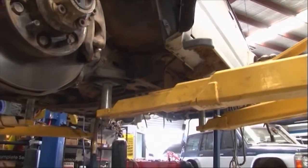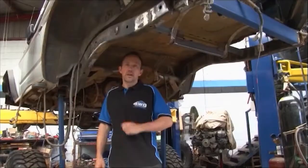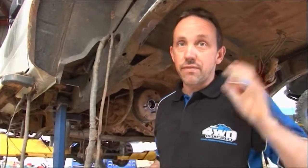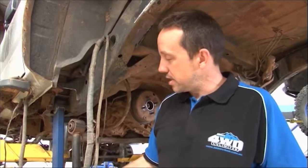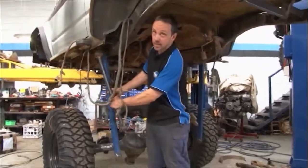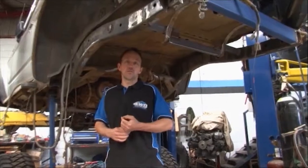Here we have a short wheelbase Patrol. We're doing a mid-wheelbase 4-link suspension conversion. Again, another turbo straight gas car. We've worked out with a fuel tank in the rear, we can get 11 inches longer wheelbase out of this car, and we do heavy-duty rear arms to go with it, a standard arm and the heavy-duty arm. So it should handle a lot better with a longer wheelbase, be able to keep the front wheels on the ground better. We're also going to do rear bar work for it as well.